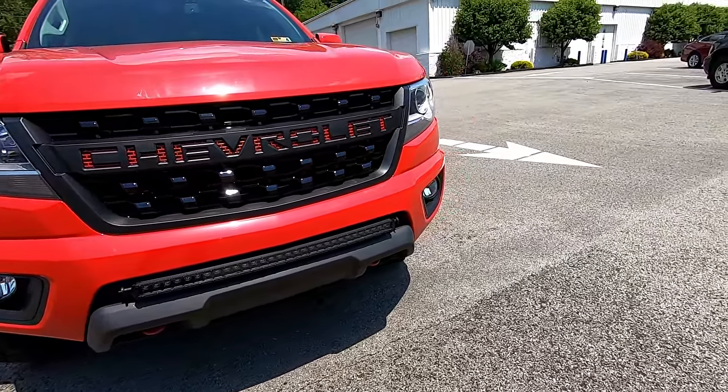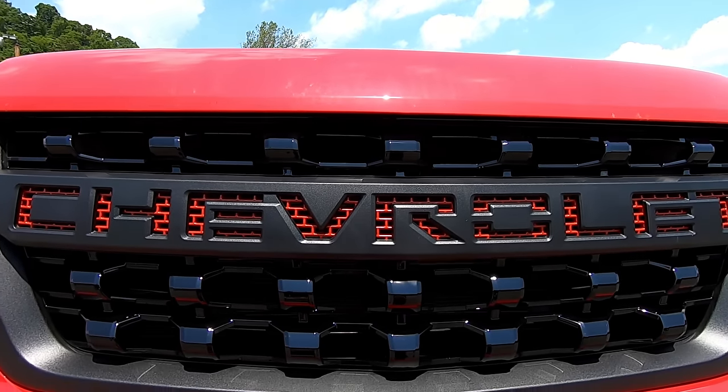The install wasn't bad at all. The hardest part, obviously, is removing the front bumper, and that only really had to be done for the hidden bumper mounts for the light bar. You can install that front grille without removing the front bumper, though in my opinion I would just remove the front bumper anyway — it's really not that difficult. The side parts of the bumper with the three 7mm bolts are probably the hardest because the top one has real tight clearance, but once you get in there and get those loosened up, it comes right off. Anyway, guys, that's going to do it for today's video. If you have any questions, feel free to shoot them in the comments section down below, or hit me up on Instagram, Twitter, or send me an email at horse.power.obsessed@gmail.com. Give me a thumbs up if you like this video, subscribe if you haven't yet, and I'll catch you guys in the next upload.